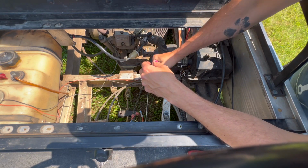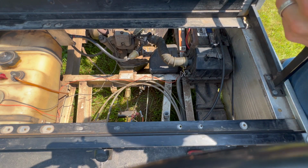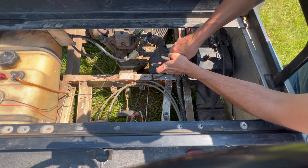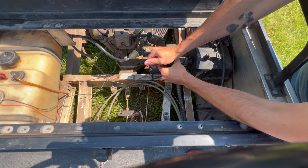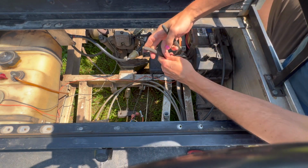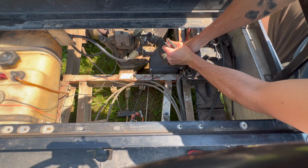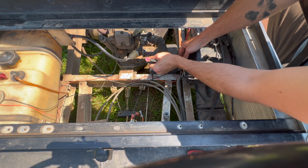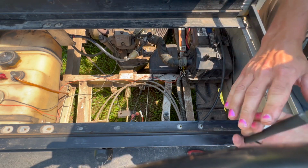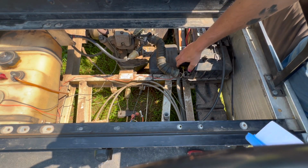It's kind of hard because that complaint of it not running as well as it should, well, that's kind of a subjective thing, right? When I was running it, it seems like it wants choke. It wants choke, right? And that's normal for a gas engine to start up cold. But I drove this around kind of wide open to really get it going, and then it would run fine. So it's like it really needs to heat up.